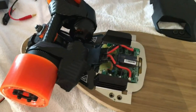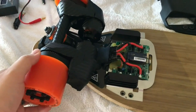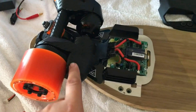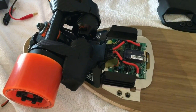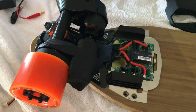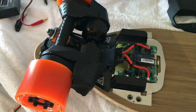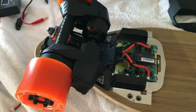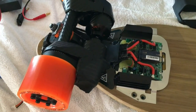My personal opinion about the boosted board is that for the Dual Plus, there's no software limiting — it's a hardware limitation. With the 75mm wheels, the 3.5 gear ratio, and 190 KV motor, it doesn't even bring it up to the listed speed of 22 miles per hour. So I would say the motor KV I've read isn't actually right and it's more like 220 KV to be able to reach those speeds, and they're not limiting it at all.